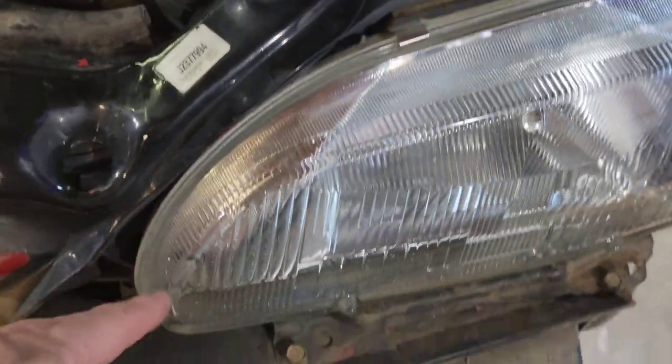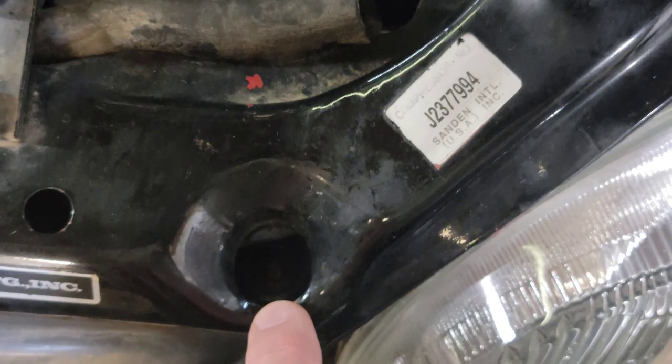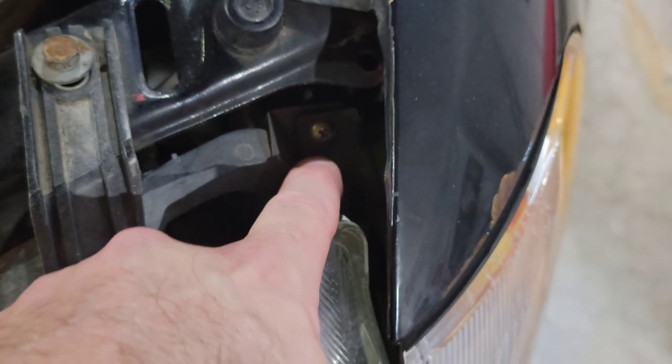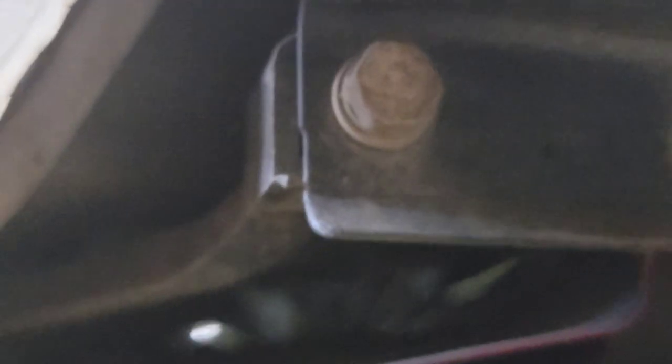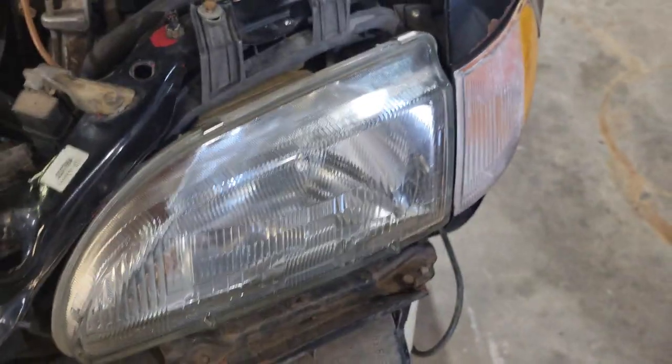Really quick, we're going to do this — it's easy with the bumper off. You just take this 10mm bolt off, loosen it up a little, and slide it out. Get the two 10mms right up here. Then you have your corner light bolt, your screw right there, and I believe there's one more down here that goes into the headlight. We're going to change those out really quick and it should look much better.